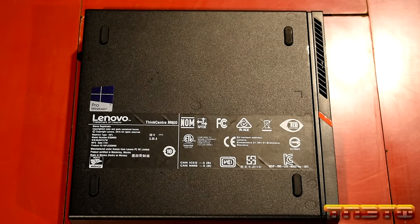Shut down. There we go. The system will shut down. Now, when MemTest was running, the fan on this did kick up. I mean, with this system, you could start to hear the fan. I mean, she was working. So I may have to reapply the thermal compound, but we'll handle that here in a little bit.